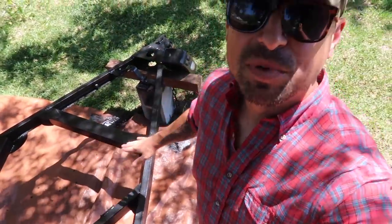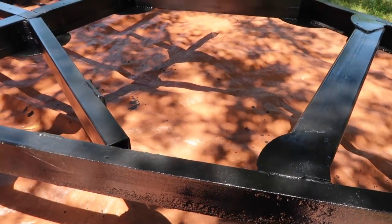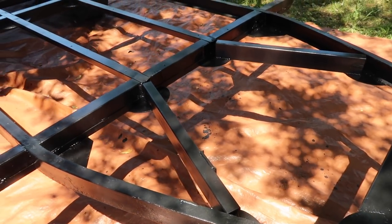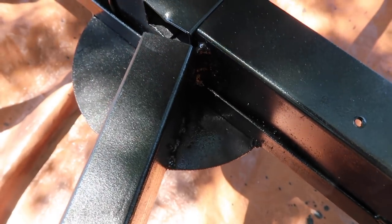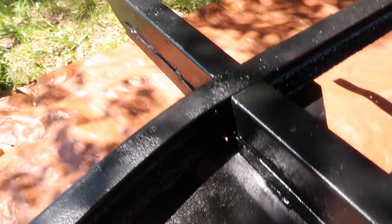Stepping down further on the frame, you can see these added structural pieces. The Airstream frame originally had a formation of these structural pieces, but the metal was a lot smaller than the metal we reinforced it with. We also added gussets all over — most importantly up front — so the weight has an even wider range of distribution on the frame. Everything is welded together super nicely. The Argosys were made to be very lightweight, which was part of the selling point, but the metal they used was a lot thinner and lighter weight than many trailers. These gusset plates are a great sense of security, ensuring tension and wear from the road is distributed even better throughout the frame.